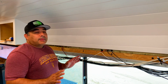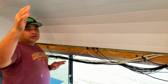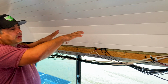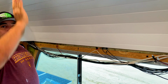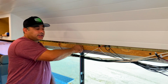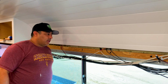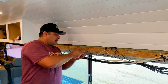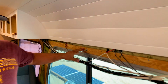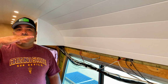When the bus was originally a passenger bus, these bolt holes here would have been used for the overhead, where people store their luggage. They would have put it on a shelf that would have been about here, and there were supports hanging from the ceiling and then bolted into this wall with pretty good size heavy bolts. One of the issues we're running into is that this is not perfectly vertical. So we went out and bought some bolts, and when we put the bolt in, it shows how not vertical it is. It turns out this is down at about a 7-degree angle.